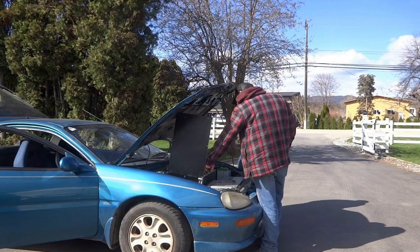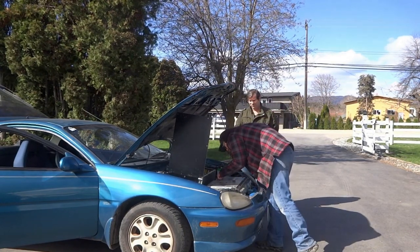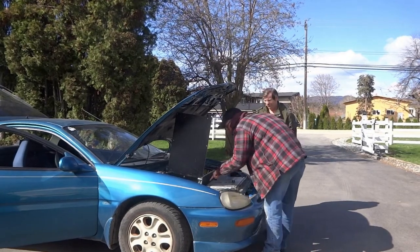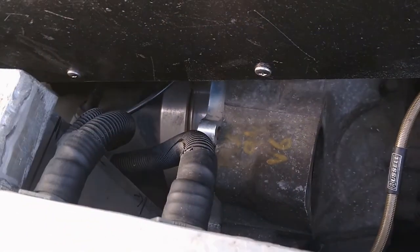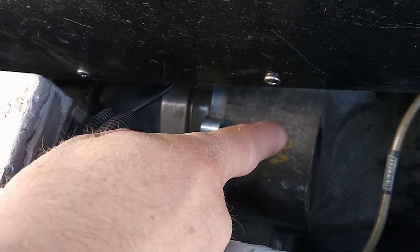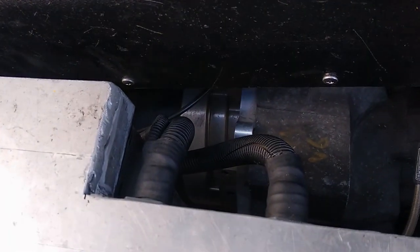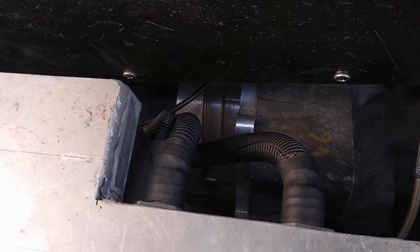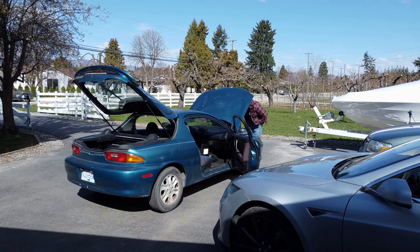He's got a little heater contactor down here as well, so there is a heater in the car. And you can just see down at the bottom there — it's the little AC 50 motor. It's quite a bit shorter than the AC 75 that you had on your Neon, and it's coupled up to the G5M Mazda transmission. They probably built the adapter plate between the transmission and the motor — you can see all the other aluminum machining that's done on it. It's incredibly well built.